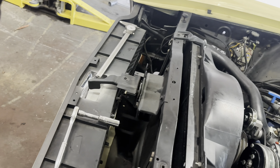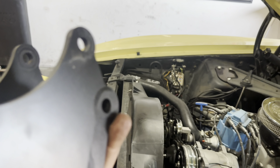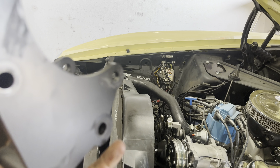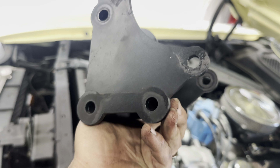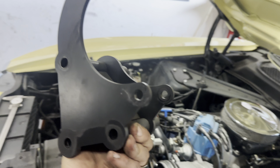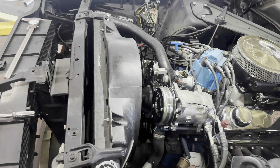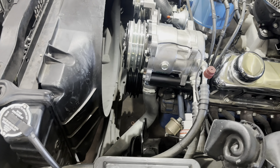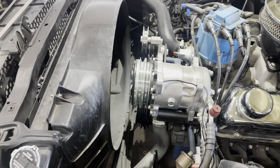That bracket — did it go like this? No, it went like this. Yeah, because the power steering bracket bolted right to that, and the compressor was like that, and that's how they tensioned it. And it's funny because there was no adjuster there, which is strange, because there should be an adjuster. So that was designed for the compressor to be the adjuster.